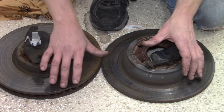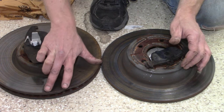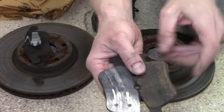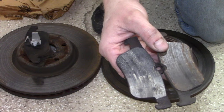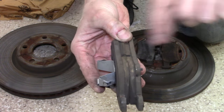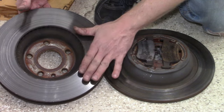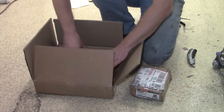At this point I'll pause to show the front and rear rotors and pads together. The indicator that it was time to work on the brakes was the rear pads starting to grind on the rotor — the pad level had gone all the way down to the metal backing plate. Interestingly, the front pads didn't wear as fast as the rear, which is unusual since typically front brakes go out earlier because they deal with more load — that's obviously why they're bigger.